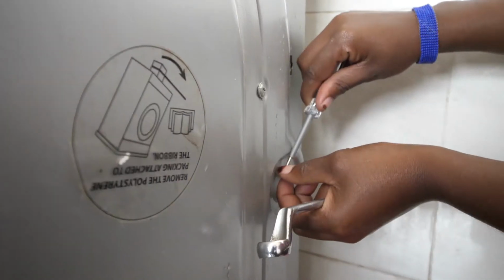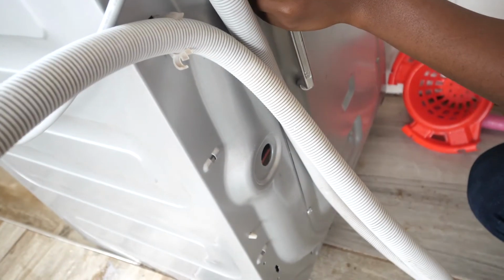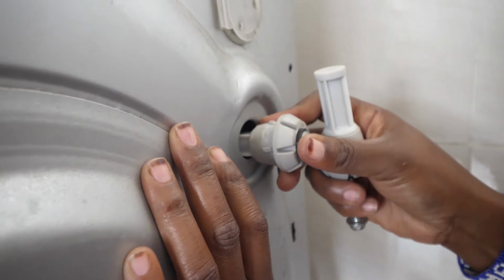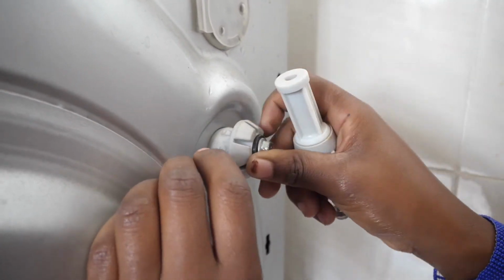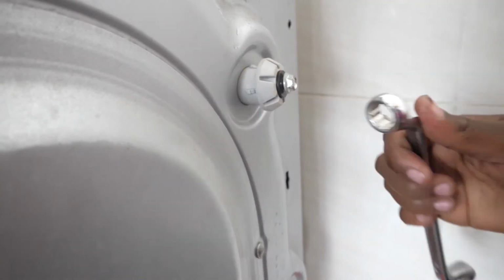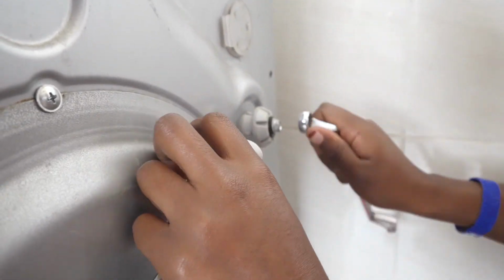Lastly, you will need to secure the machine's drums using 4 transit bolts. To do this, remove the coverings at the back of the machine. Insert all the transit bolts and secure them tightly using a wrench or spanner. Once finished, allow the machine a bit of time to dry up before proceeding with packing.